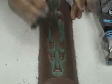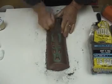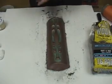The following day we went back to sand this piece. We let it dry and let the resin component cure out for a full 24 hours before we went back to buff and polish it. Ron is going back with different grades of steel wool, starting with a fairly coarse steel wool and following up with finer and finer grades until finally using quadruple-ought steel wool to polish. With the C coating it takes a good bit of abuse and takes a great shine. This piece was done with the C copper coating, finished with light green patina, and polished to a shine with quadruple-ought steel wool.